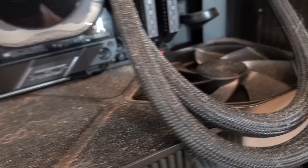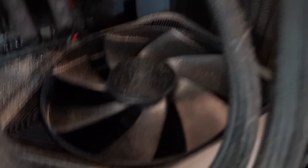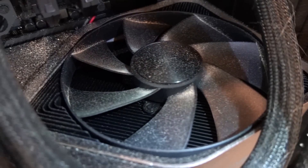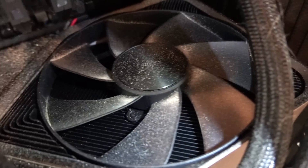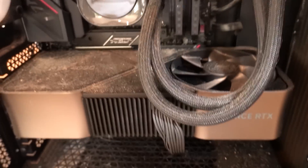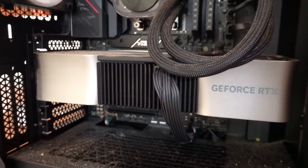Like our GPU — poor 4090 — the fan's not looking good, guys. The heat sink beneath the fan on our 4090 doesn't look as bad from this angle, but this is one of the reasons why components get hot when they're dirty. Dust will land on the aluminum fins of the heat sink, and the heat sink is supposed to absorb heat while the fans dissipate it. But if there's dust coating the aluminum fins, it's essentially trapping the heat.